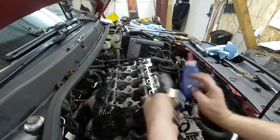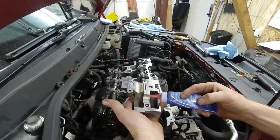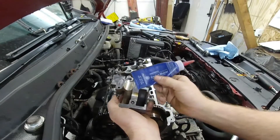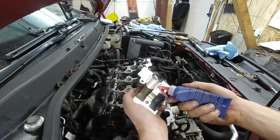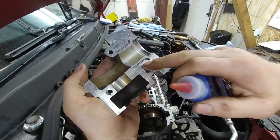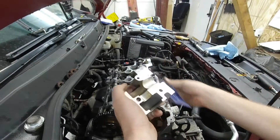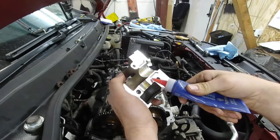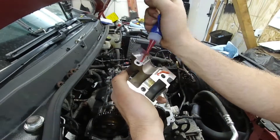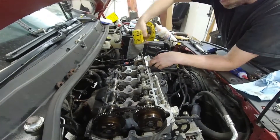I am almost to the point of putting the valve cover gasket on. I do have to put the high pressure fuel pump and this cap for the camshaft in — we are going to need lube here and here. What I have here is anaerobic gasket maker. You want to clean out these grooves — they're actually there to capture the gasket maker before it gets over where you don't want it near that piston mechanism for the high pressure fuel pump. You put it on this side so when it goes that direction it doesn't make it past that groove. Just a real thin layer — you don't need much and it will be enough to do the job.